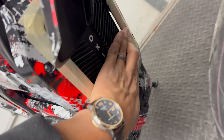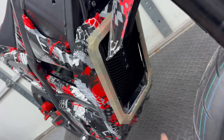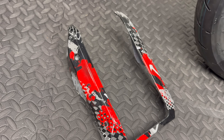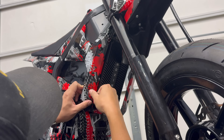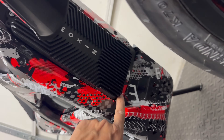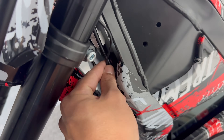Just mock testing it against the controller after cutting out the whole center section. We're definitely going to have to do additional trimming, especially up top — it's still hitting the mounting point of the controller, so I'm probably just going to have to cut the whole top section off. Once I get the front cover to seat completely flat against the frame, I'll clean up all the edges with the Dremel. Here's a closer look at how it turned out — I ended up cutting much more material off than I anticipated, but it actually turned out pretty smooth around the edges. And this is what it looks like reinstalled. The tolerances all around the edges of the controller, including the bottom side, are very tight. The right-hand controls and throttle along with the rear brake line are tucked between the controller and the cover, and on the left side we have the regen and left-hand controls tucked in.